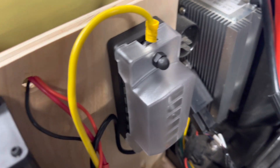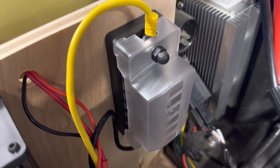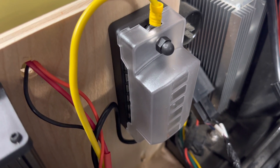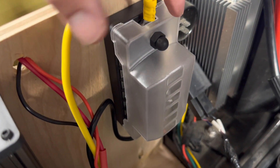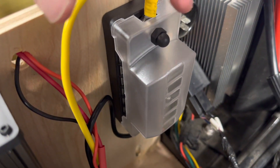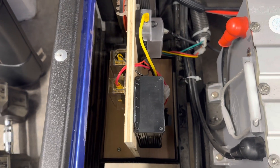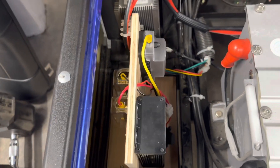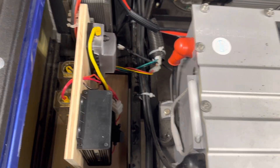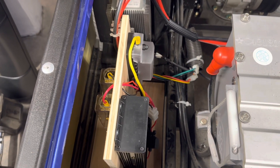If you're not going to do this, the other next best thing I've seen people do is just pop in a 12-volt battery and charge it when you're charging your golf cart. Honestly, I'm a little divided — that may still be the better way to go. But in either case, you're going to need a fuse box. And if you're going to have a fuse box and an additional battery, this whole setup cost me $60. A good 12-volt battery will cost you a minimum of that, and you still need the fuse box and all the wiring. I kind of like this because I don't have to charge two things — I just charge the big battery and I have a seemingly unlimited supply of 12-volt until I drain the main battery.